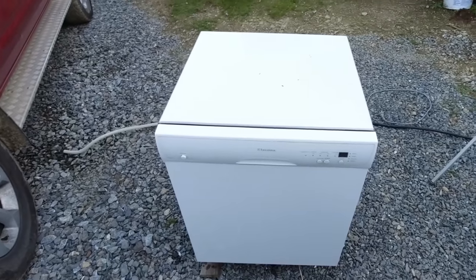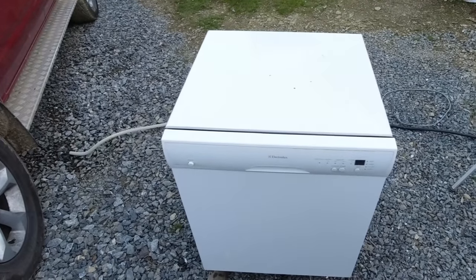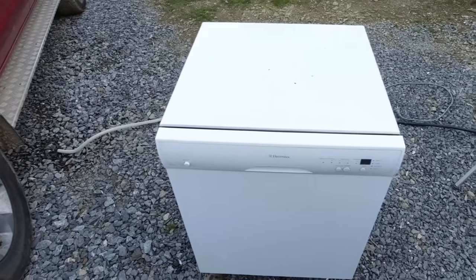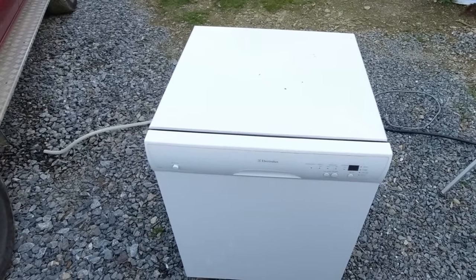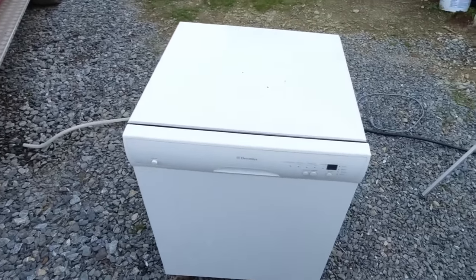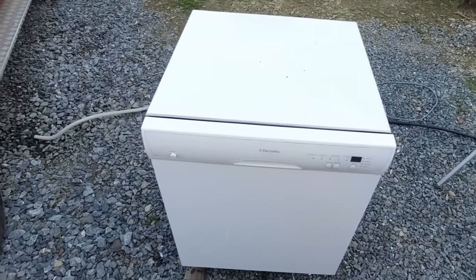So if your dishwasher stops heating, that's a good thing to check, and it's not too hard to do if you've got a soldering iron. Also, if you're living off-grid and want to use a dishwasher, here's a good trick: just disconnect that relay pin and your dishwasher will use a lot less power. Otherwise they use quite a bit of power, especially feeding cold water in since they have to heat it all up. If you're making your own hot water from a fireplace or solar, just feed your hot water into the dishwasher, disconnect that relay pin, and it'll use next to no power. That's all there is to it — thanks for watching!